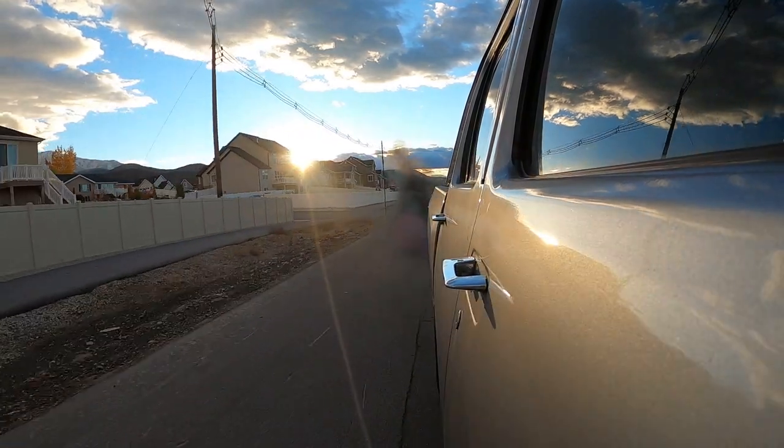You can see here, from a dead stop takeoff, this is a ton of smoke — more smoke than this truck has ever put out. Essentially the converter is more efficient, it's tighter, so at idle it's actually taking more energy to idle because the converter is taking some of that energy, and from a dead stop it's taking more energy to get the truck moving — more energy to get through the converter to put that power down. That's not a bad thing in the end when we need that energy for towing, speed, and things under load — that's when the converter will shine. We just need to make some slight adjustments.